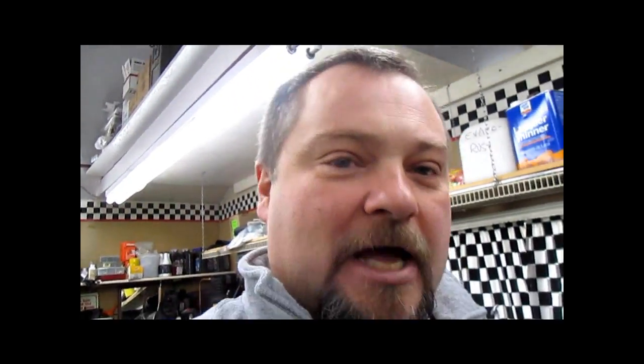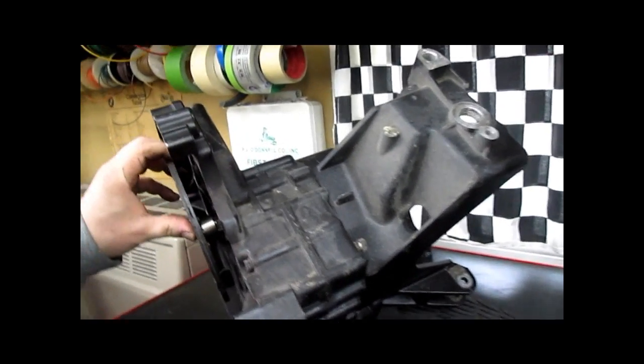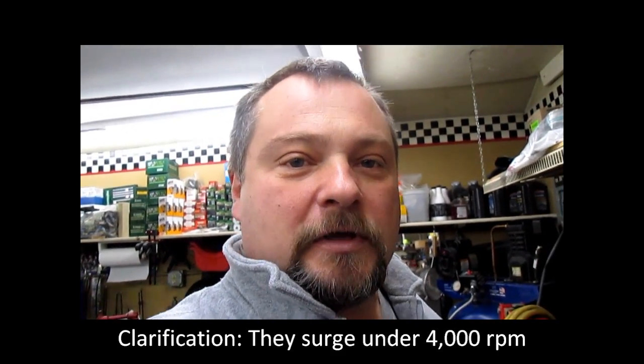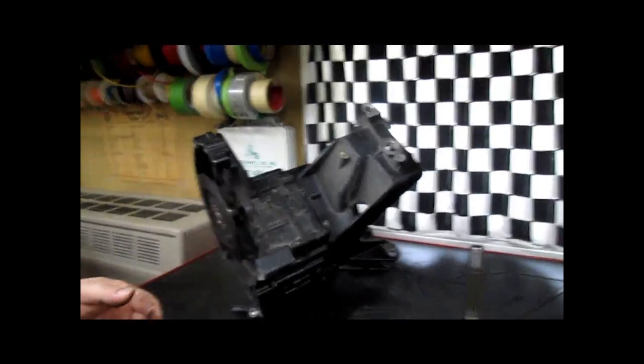To answer the question of why it is the six-speed transmissions stripping the shaft: the reason you don't see the R850 and R1100 stripping is because they used a five-speed transmission — you're going down the road turning much higher RPM. Those bikes surged so horribly that nobody in their right mind rides below 4,000 RPM. When they came out with the six-speed, first introduced in the R1100S and followed by the 1150GS, people were lugging down the road in sixth gear doing 60 or 65 miles per hour. Don't put it in sixth gear until you're doing 85 or more.